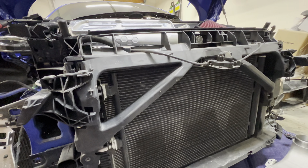Getting ready to do some modifications to the core support. There's a bracket with a T30 that you can raise up and get out of the way. I did that and then outlined exactly how Rada has it specified. Essentially, this is where the intercooler is going to sit back against, and you want clearance all the way up to here for that part of the intercooler. I did that for both sides. They specify that you only want to cut above the first part of the tab so the top part is still intact and holds everything together.